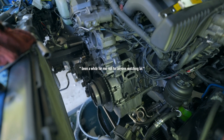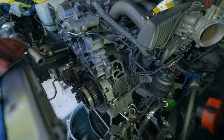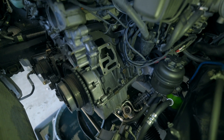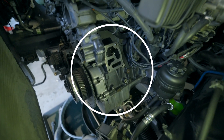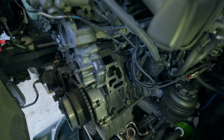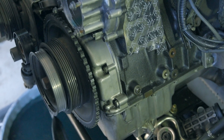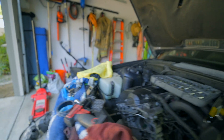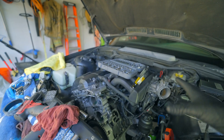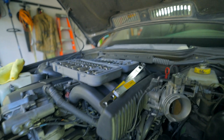It's been a while since I updated you guys. Clearly I have a ton more parts out of the car. I'm kind of doing a few videos at the same time, so I am in the middle of also filming the oil filter housing gasket replacement video. This part of the engine was absolutely caked with oil — the oil filter housing gasket has 100% failed. I'll put in a clip of what it looked like before and after. I'm going to take the oil filter housing to work and clean it off, and I'll update you when I start taking the intake plenum off.